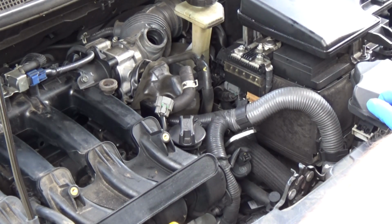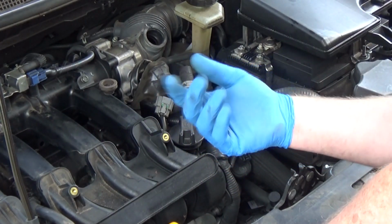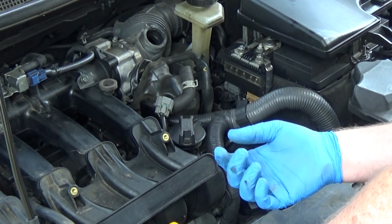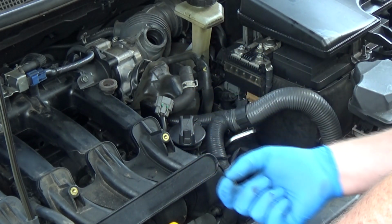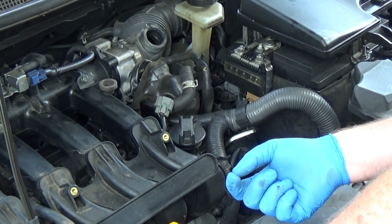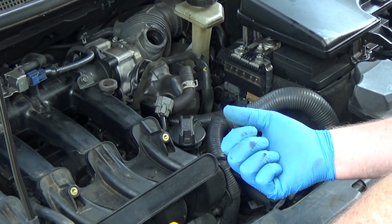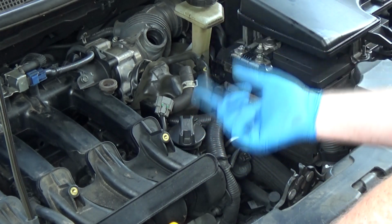And if that's the case, I have to take a lot of stuff apart. But it's more than likely leaky valves, right? It could be the seal inside there that's causing it to not set quite right. Cracked head, blown head gasket, and I'm thinking that this is actually a cracked head. It could be a broken valve, right? Oh man, all I know, that's not good.